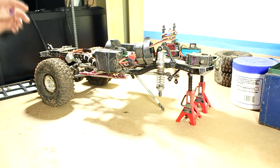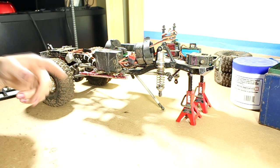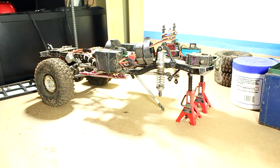All I'm going to be doing in the rear axle is literally just putting in new gears and another Incision locker, which you saw me do in the first video, so if you want to see how to do that, you can go check that out. And then the transmission, I'm literally just tearing it down and replacing bearings.